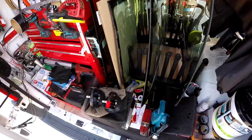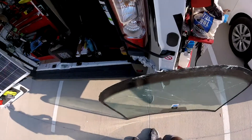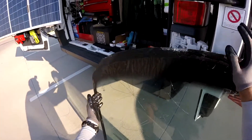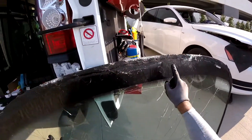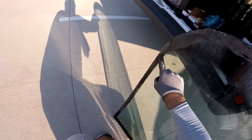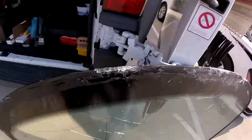Finally, we already pulled the windshield. Let me show you — it was really, really difficult. I tried every kind of tool: my long knife, my big knife, wire — the wire broke a couple of times. Right here, going through the glass, you can see more than two inches of glue all along the bottom. But you can see here — nothing, completely clean. That's why the customer noticed the window was coming apart from this part.